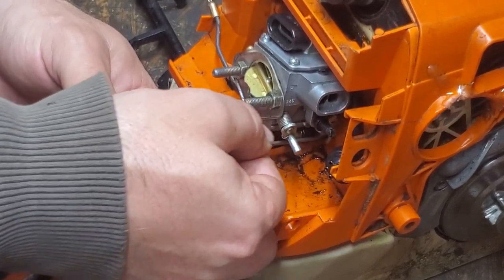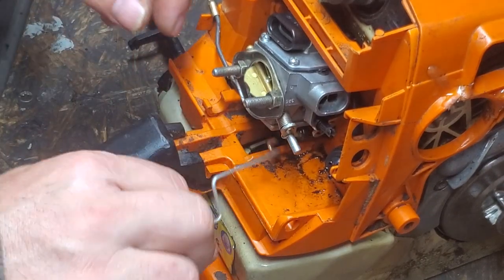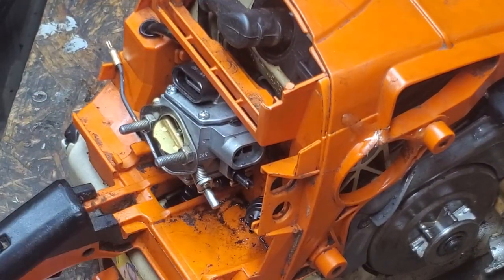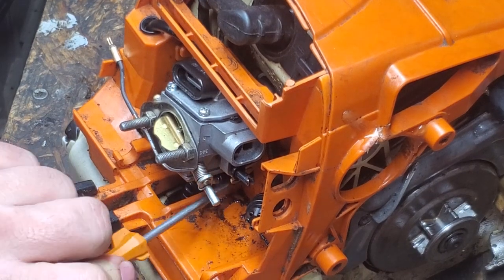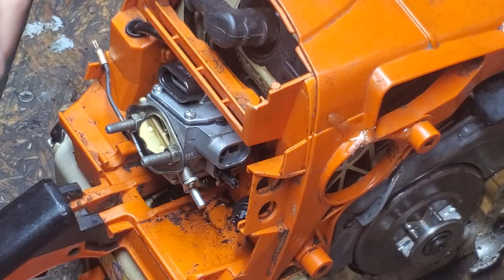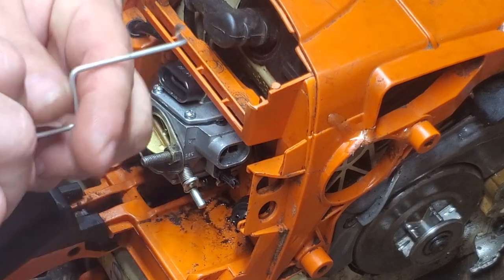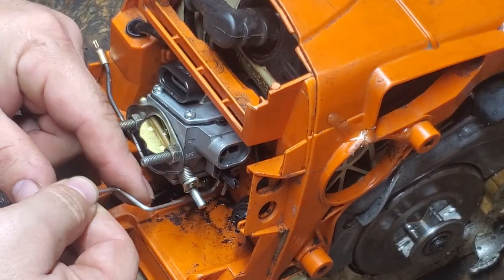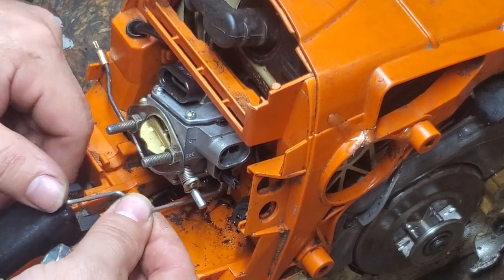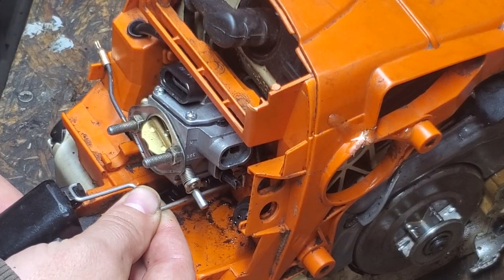That area, because otherwise it just wants to turn on you and push out, because you're holding tension against the spring of the throttle lever on the butterfly valve on your carburetor. We've hooked it into our carburetor back here. You guys can see that pretty good. It hooks into your carburetor back here — as long as you've got an OEM part. Hopefully if you ordered a Chinese one they didn't give you an open slot, because I don't think it would work on this one. Hook that in — simple. Keep it level, parallel to your bench, push it in.